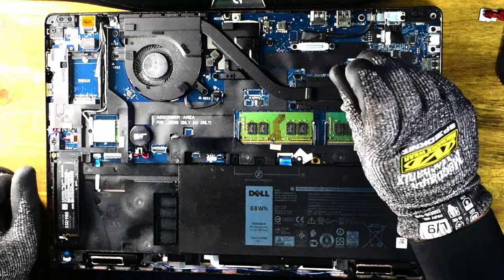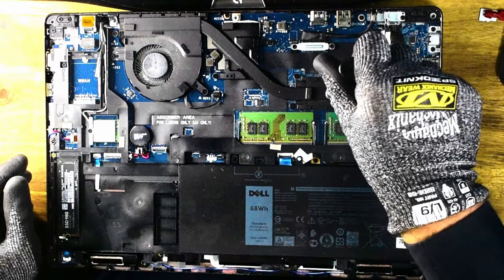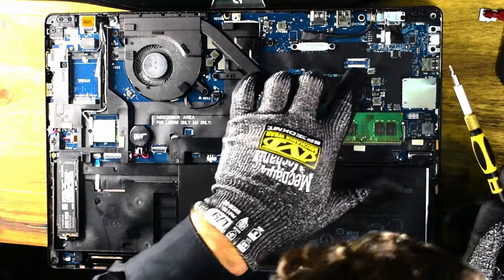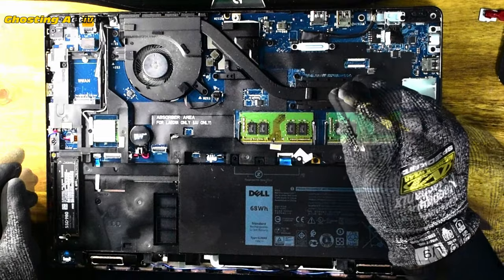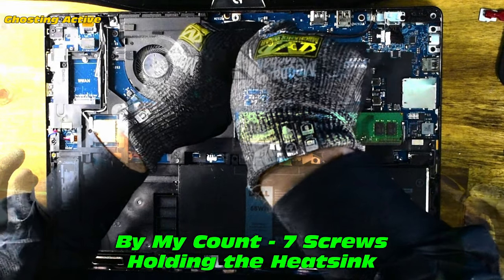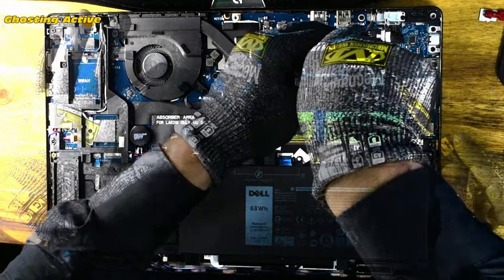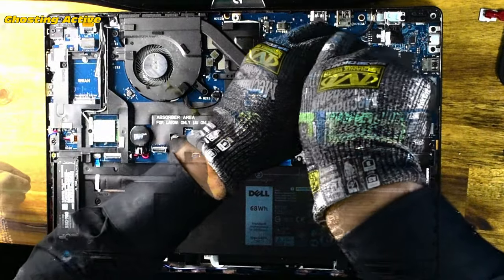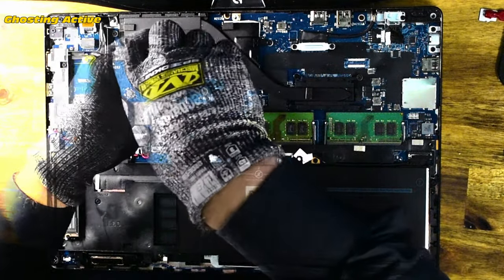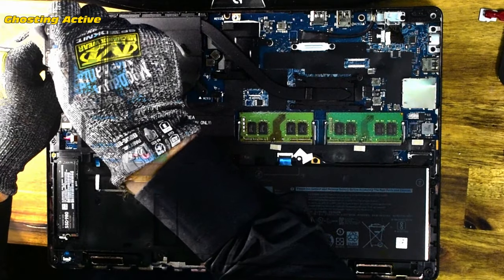Let's try to get this particular shroud off. Using precision Phillips head tools — the Sprotech brand, really handy with quite a lot of bits. Having a bit of trouble finding the right size as these are very small screws. Need to apply a little bit of force to ensure the Phillips head stays nicely seated. Last thing you want is to accidentally strip one of these screws — it's really annoying when it happens. There's also the power connector there which you generally want to remove.